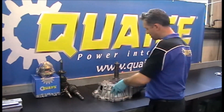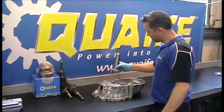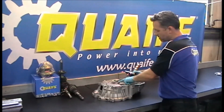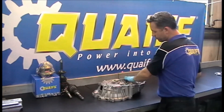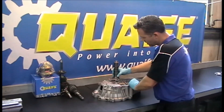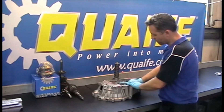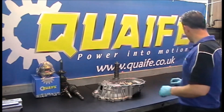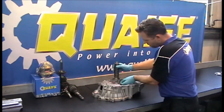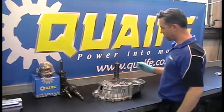This is the standard case, the bell housing end of the case. The next job is to machine the case — it's critical that this face is flat and the right distance from this datum. The sole plate of the cam drum is going to sit on there, so this needs to be machined away and shimmed with the shimming washer supplied in the kit. That just slides underneath the base plate and it's bolted down into place.